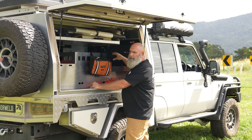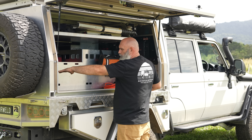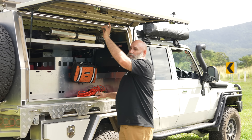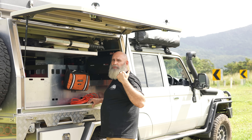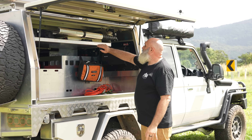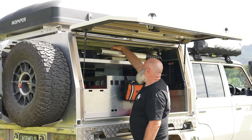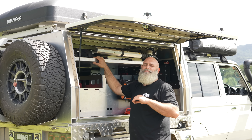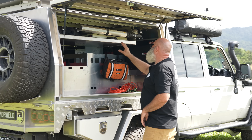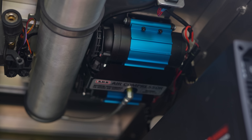At the rear of the vehicle, with the JMAX Super Chassis you get the rear setup with your towbar and winch mount — everything all in one. Rear winch: do you need one? Not really. Does it help? I've found out yes — after using it twice in one day for about four and a half hours. If you're going somewhere remote, there's no phone signal, you're solo — that's what you want. A satellite phone's great, but it's not going to rip you out of a 40-metre bog back to the trees. For remote travel, do that.